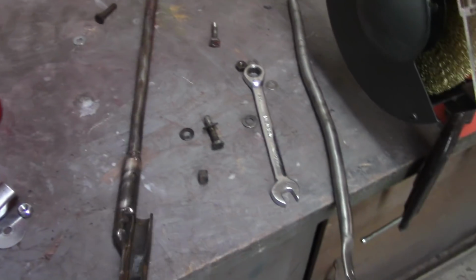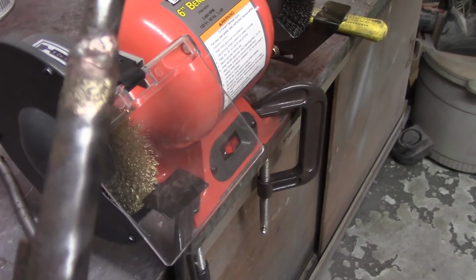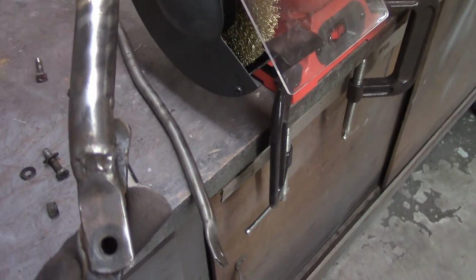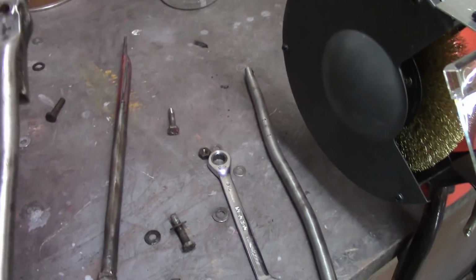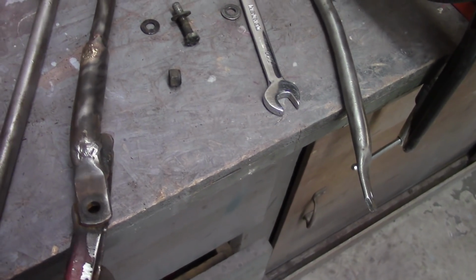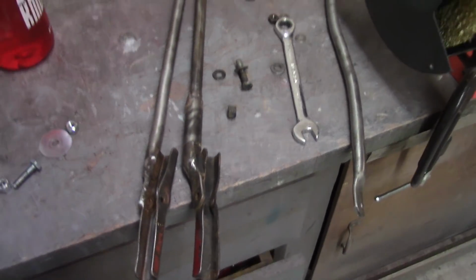But to get back to the bonnet stay thing that I posted a video about the other night, I think what I got going on here is I have a feeling I cleaned this piece up. This is from the black car, based on how that looks, and the bend there that you see, it comes in straight and then bends down pretty good. I have a feeling this may have been repaired at some point, and you can see that this one doesn't bend like that, and also that extra collar there kind of leads me to believe that it broke and they tried to stick the pipe inside of a pipe and fix it, and it's also a different length, and it's also twisted. If that is true, they didn't do a real bang up job.